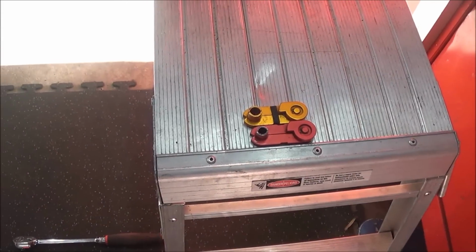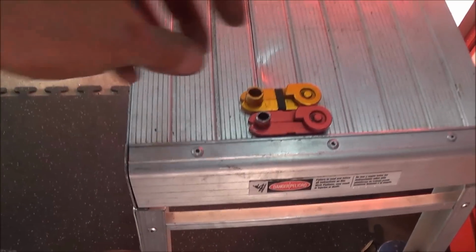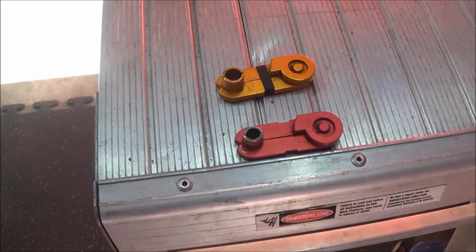Okay, so that seemed relatively painless. This pump actually is a lot quieter than the one I took out, which that's actually nice too, I guess. Anyhow, I didn't have to use anything really special to do this job except for these two fuel line disconnect tools. You can get these pretty much anywhere. You have them at the auto parts store, you can get them at Harbor Freight, the Chinese tool store, online. For a couple bucks, and they'll keep you from killing the fuel lines when you take them off. So anyhow, that's all I got.